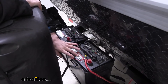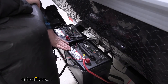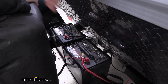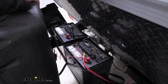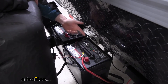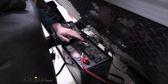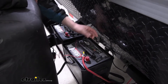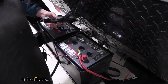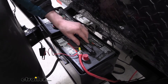I've gone ahead and taken off the cover for our original batteries on our trailer here, just so we can get an idea of what the batteries are. We're upgrading from the customer's current batteries to the newer ones. So looking at the old ones, we can tell that these are flooded lead-acid batteries because we have caps on top that allow us to perform maintenance — just ensuring that the electrolyte is topped up. You can add distilled water into the caps if it gets low. Sometimes the caps are individual, sometimes they're all linked together like this one here. It looks plenty topped up inside, so we're not going to be doing any maintenance on this one, but that's a good thing to keep an eye on. This battery has been in service for quite a few years.